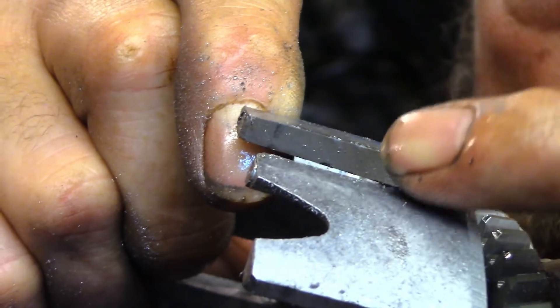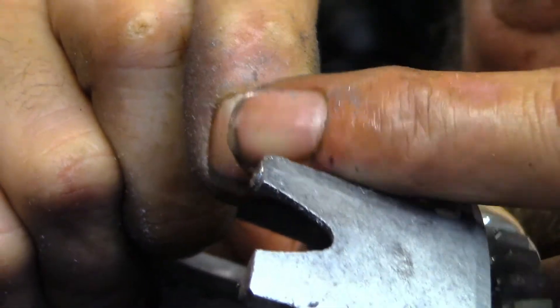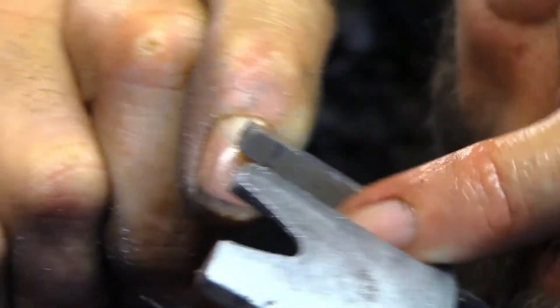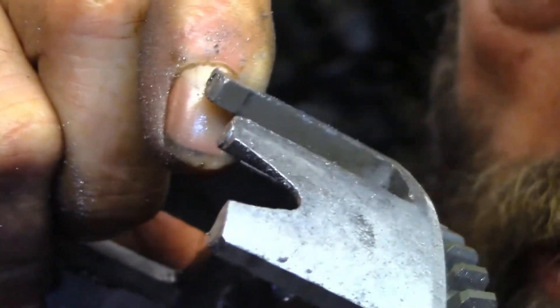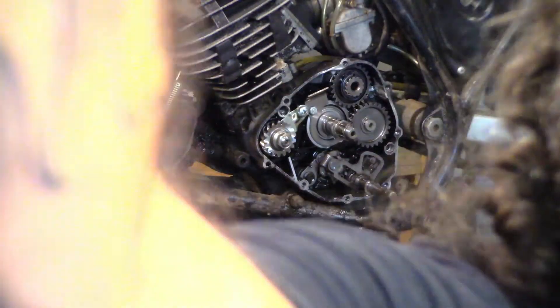This is the end result. There's one little deeper notch here, but all I did was carefully use a flat file to slowly just flatten them out. I did all of them — all the same. Now I'm going to hit it with brake clean, clean it all off, hit it with a blow gun to get all the filings out of it, wash my hands maybe, and then it's time for reassembly.